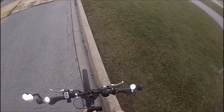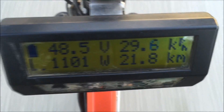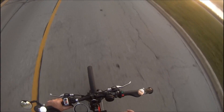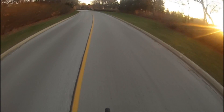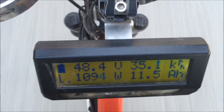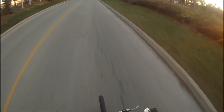Here's a good section — an uphill climb for the Magic Pie Edge, 48 volts, 500-watt motor, climbing this grade. You can see consistently the Edge is pulling about 1000 to 1100 watts. That's the peak output. It climbed that hill at 32 to 36 kilometers an hour.